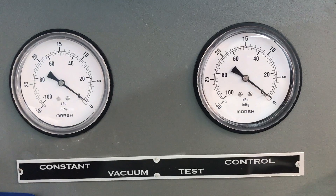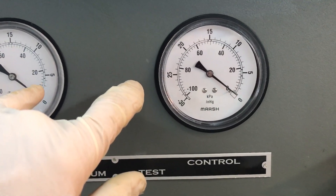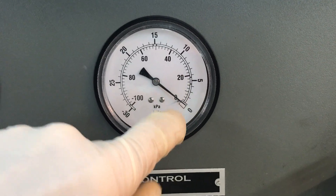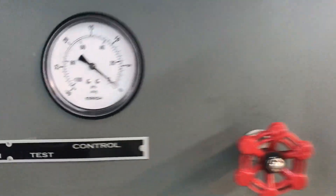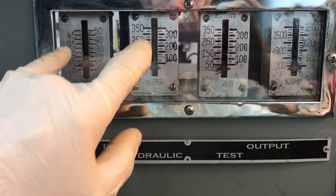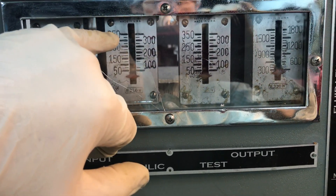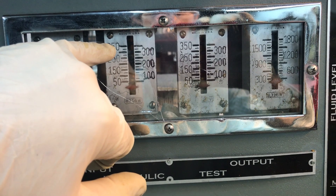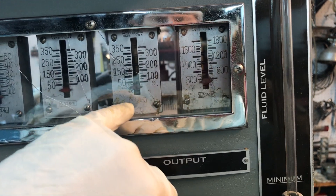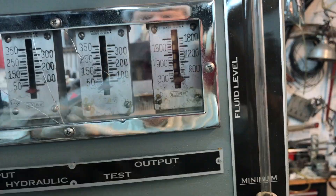When the vacuum pump on the test machine goes to work, both these gauges are going to register the vacuum produced by my vacuum pump. Then as the booster is activated, this gauge is going to go to zero, and as soon as it is zero the booster is fully activated. On this side we've got the hydraulic input — both gauges are tied together, this gauge goes up and maxes out, and this gauge reads the final input pressure supplied by my master cylinder on the test machine. The output gauges are also tied together — this gauge goes up and maxes out, and this gauge will read final output pressure when you've got vacuum.